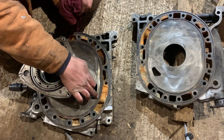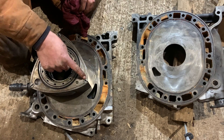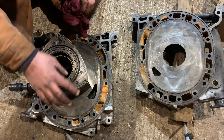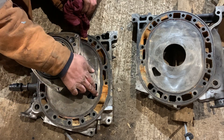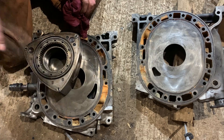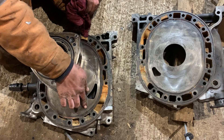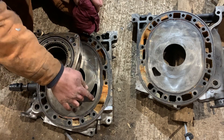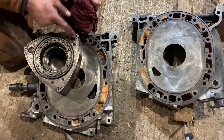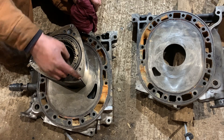The reason you need to be careful down here is your corner seals and your side seals. From the factory, the side seals always remain in contact with the iron — they never actually go over the port. Your corner seals are the same; they just go directly there. However, you can port down here up to a certain amount, and basically what happens is a bit of your corner seal will not be supported by the iron.